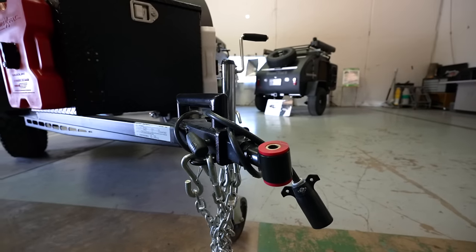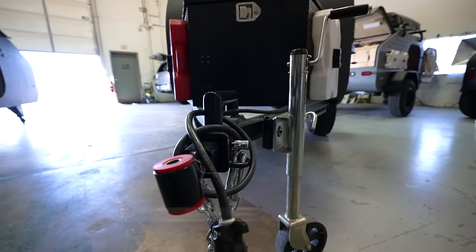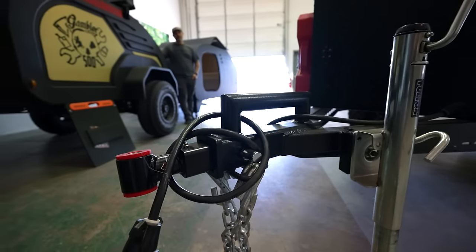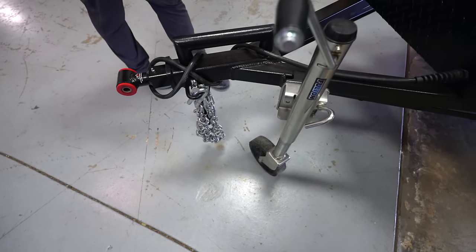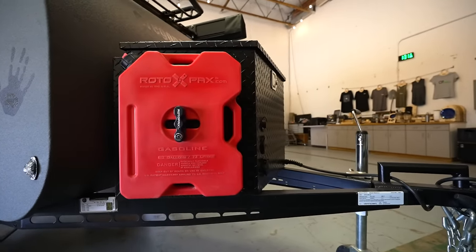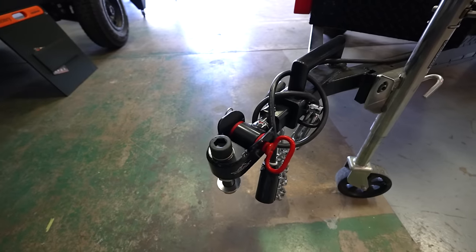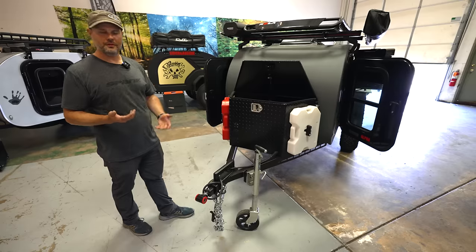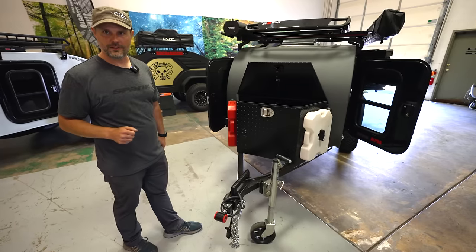Our max coupler is a really simple and effective way to make these very off-road capable. The trailer feels like it's part of the car - it feels like one integrated component. The other big advantage of this kind of coupler over a ball coupler is there's no guesswork as to whether it's connected properly. Ball couplers work fine, but if you're not paying attention when you seat them, that little cleat can end up on top of the ball, and then at the first set of railroad tracks you go over, the trailer ends up on the ground.